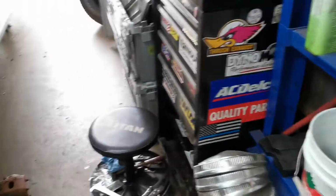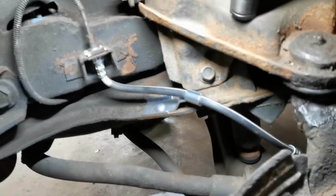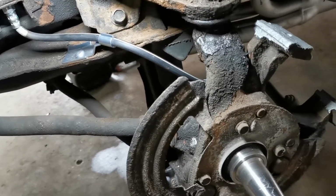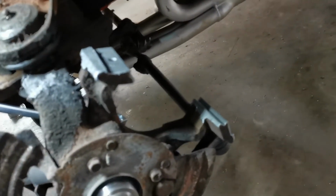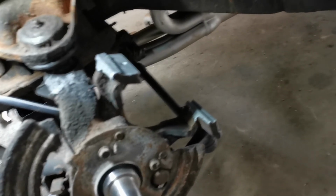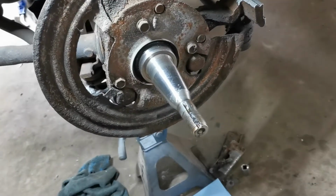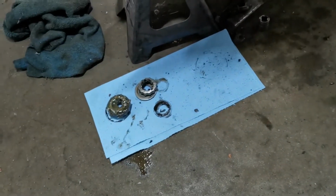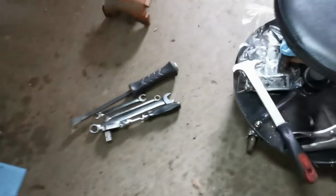Okay. So at this point, put the new brake hoses on. I got everything pulled apart here, cleaned up. I've cleaned and lubricated the... Why my camera doesn't want to focus, but anywho. The anchors. Cleaned all the old grease off of everything. And I ended up, I have another set of hardware for the brakes, so we'll go ahead and use that instead because it's a little cleaner and one of those clips is bent.